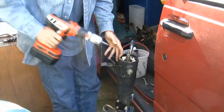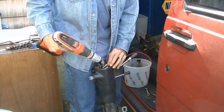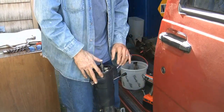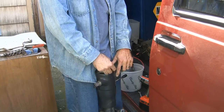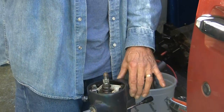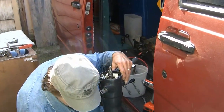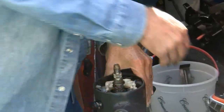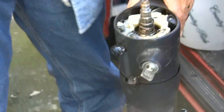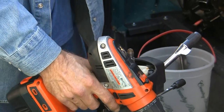I hate screwing around with Phillips screws, so I'm just going to do it like this. The first one we're taking off is the lever arm for the turn indicator. Just pull this up and out, just like that. There's a little cog on the bottom there, and that cog goes right back in there the same way. It's pretty easy. Basic stuff here. There are three screws down in there, and one's hidden. Before we do that, I'm going to take this little broken piece.